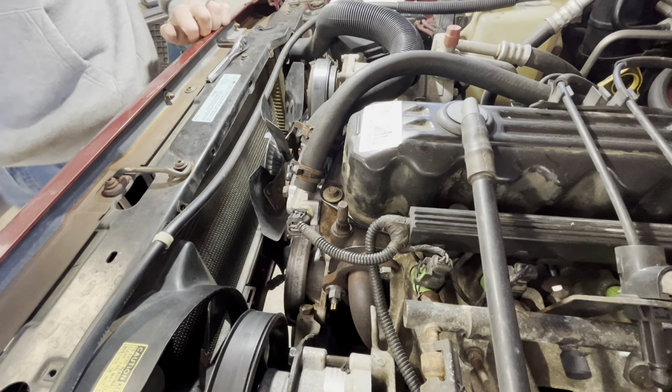So when I do those gears, I'll go ahead and put all new bearings in the front Dana 30. And right now I'm running some unit bearings of questionable quality on the front end, so that could be part of the problem too. I think another thing that's pretty popular on these is to take the stock tranny cooler that goes through the radiator and put an auxiliary one in, so that way your trans coolant's not mixing with the radiator as much. Obviously it's all the same air going over it, but anything that helps.